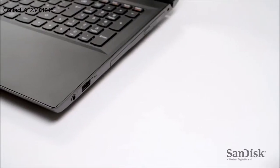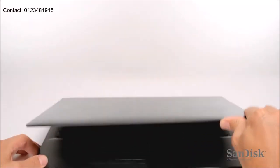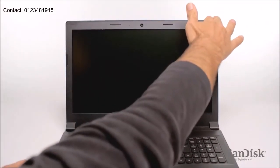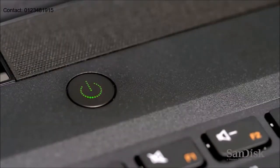If you want a clean drive, you'll now need to install the operating system from a bootable CD or USB flash drive. Make sure you do a custom install and choose the new SSD, which may be marked as unpartitioned or unallocated space. If you've cloned your existing hard drive, you're ready to go. Simply switch your computer on and experience faster boot up and software loading.